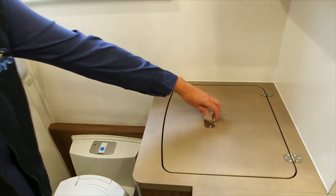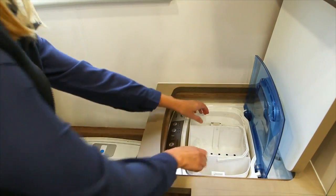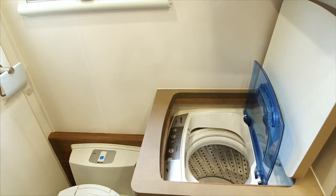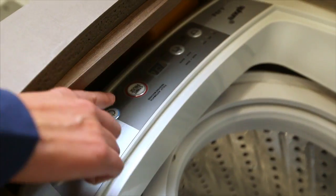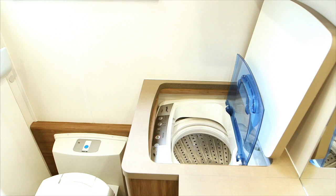The Sphere 3kg washing machine has 5 programs, from a wash-rinse-spin cycle lasting approximately 38 minutes to a simple spin cycle lasting approximately 7 minutes. Wash settings are set via the control panel. To wash clothes, select the proper water level according to the quantity of clothes. Select the program and process, close the lid and press the start/pause button. For more information, refer to your washing machine operation manual.